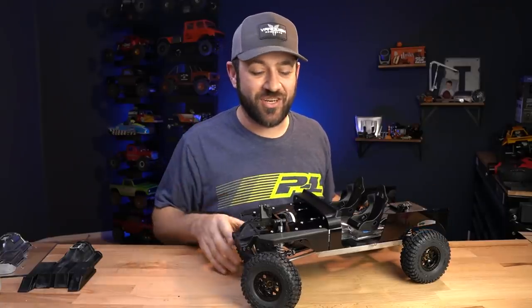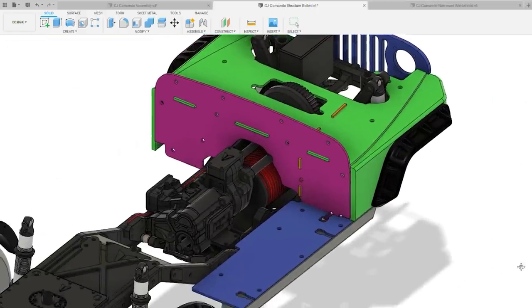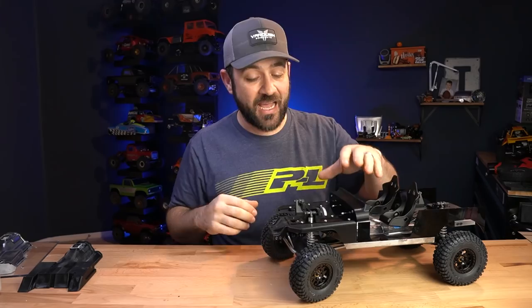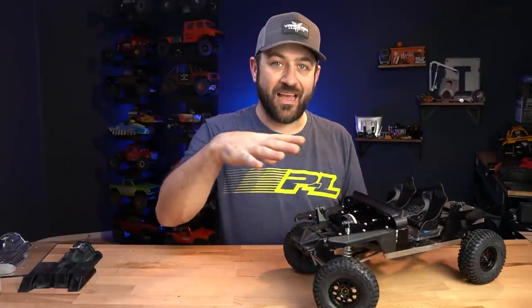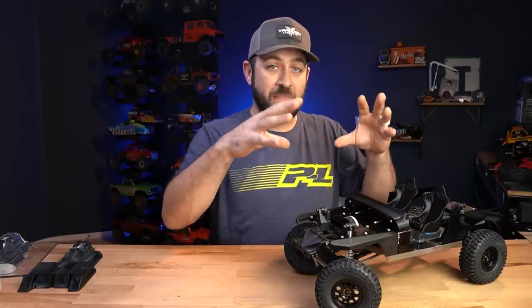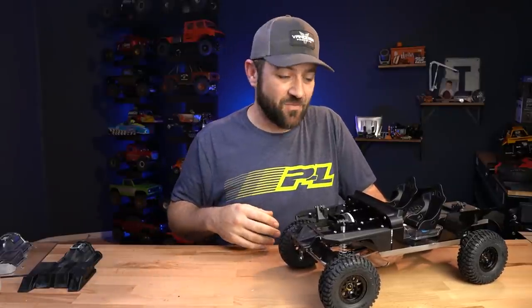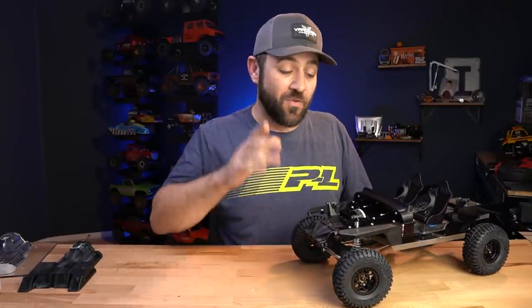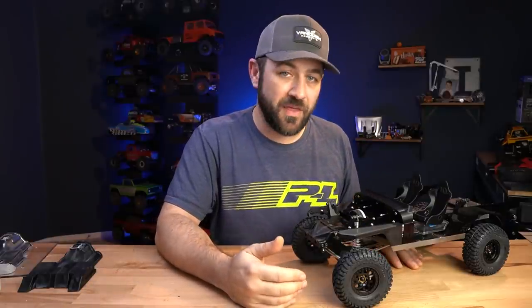The 'structure' I'm referring to is the inside structure I've designed to support the individual body panels — separate fenders, separate hood, separate cowl, separate grill, full side flat pieces, and multiple-piece rear section. I needed interior parts it could all bolt to so I could exchange parts in and out without relying on the panels fastening to each other to then mount to the chassis. The original design was going to be fabricated from 1.5 millimeter thick carbon fiber, machined on my CNC router from Stepcraft.